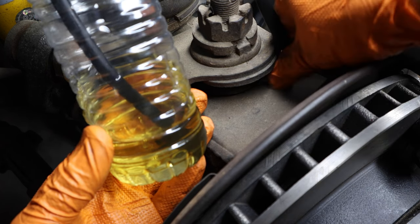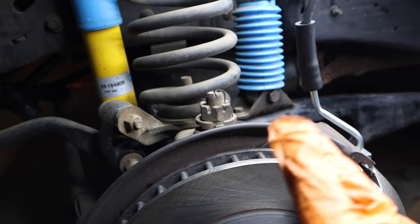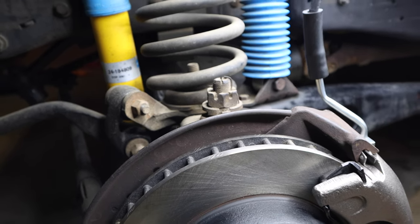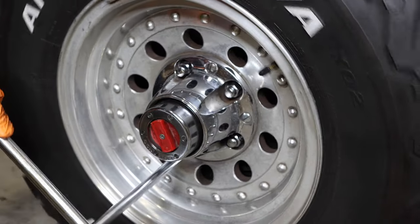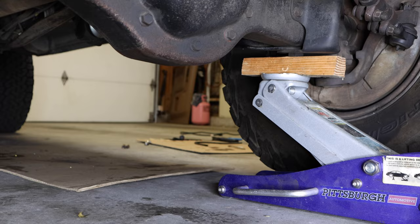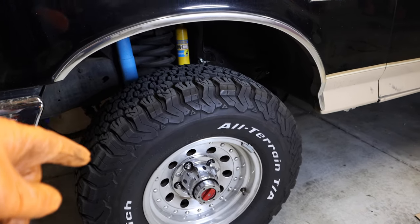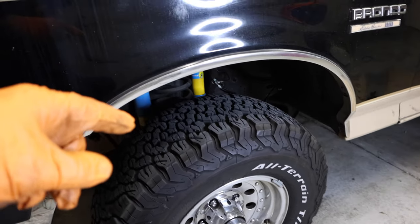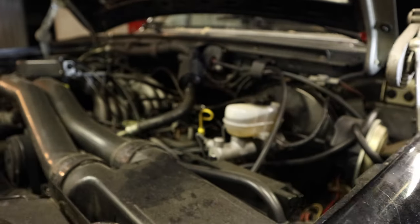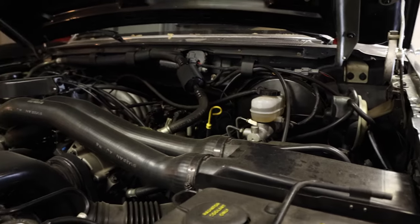If you only need to do the two fronts, do the passenger side first — it's the furthest from the master cylinder — then the driver side. I've already done the passenger side and I'm wrapping up the driver side. Now we're ready to put the tire back on and remove the jack stand. Well there you have it — we completely rebuilt our front disc brakes, everything's nice and new. Remember: use good quality parts — Motorcraft, AC Delco, whatever's OEM for your car or truck. You're going to be a lot happier with quality parts on a big job like this. If this video helped you, please like and subscribe, and I'll see you in the next one.